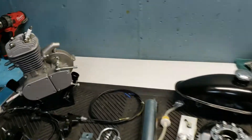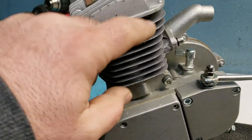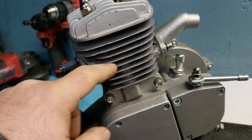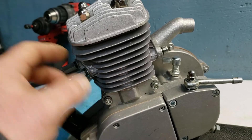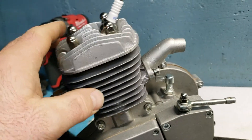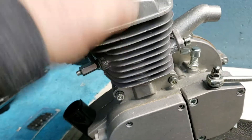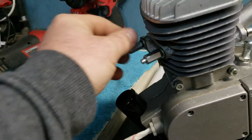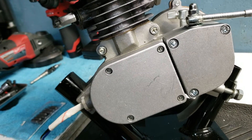What that means is I go through the whole engine. I clean the transfer ports — I'll have pictures posted showing what they look like from the factory. There's a lot of buildup of metal in there from the casting and I clean those out. I put everything together using assembly lube, lube everything up real good, upgrade the muffler studs, and use coupling nuts. I take off every cover and make sure everything's tight and well lubricated.